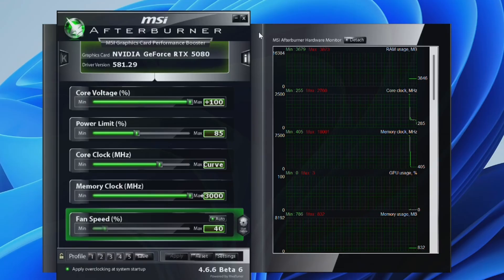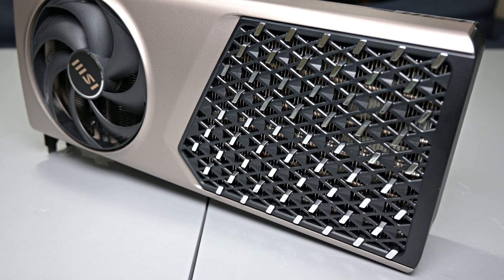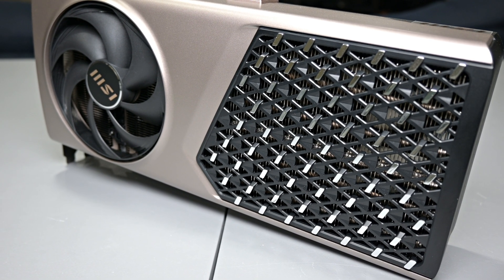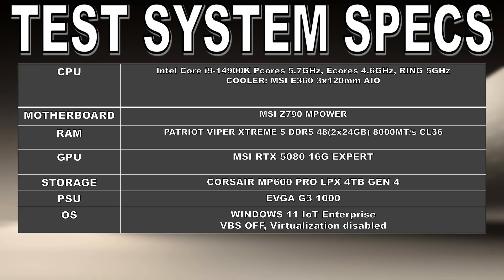I did want to point out that the 5080 is just a more power-starved chip, so maintaining over 2900 megahertz is more difficult for my sample with this configuration, unlike my 5070 Ti which still did it with the same sort of aggressive power tuning. Silicon Lottery comes into play here as well. Also, since I posted my review of this card, I've flashed a 450W VBIOS, so you'll notice stock boost is a bit higher from last time. I'll have full specs for the test system in the video description — let's get into the benchmarks.